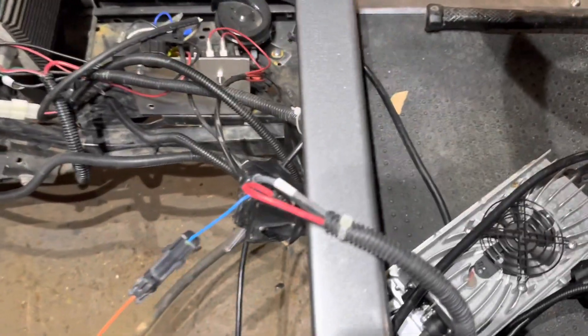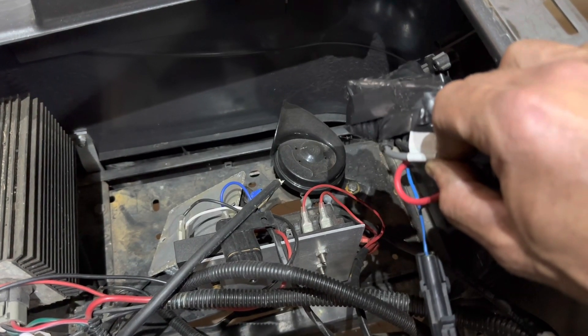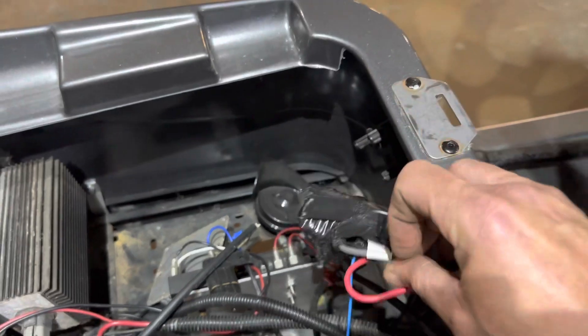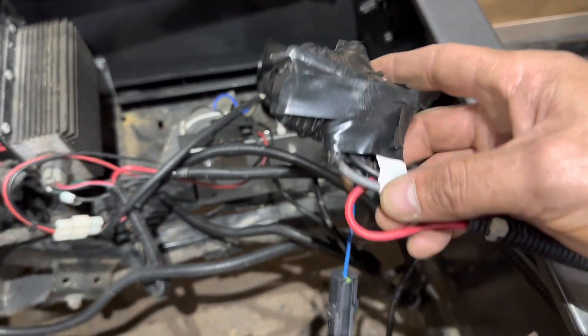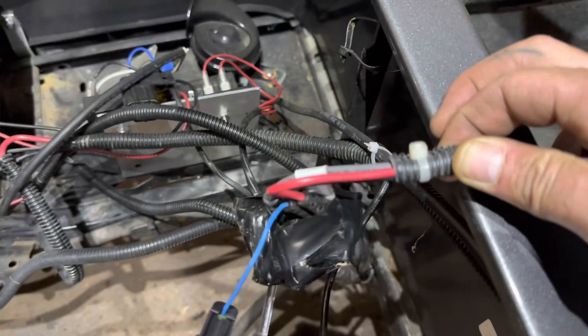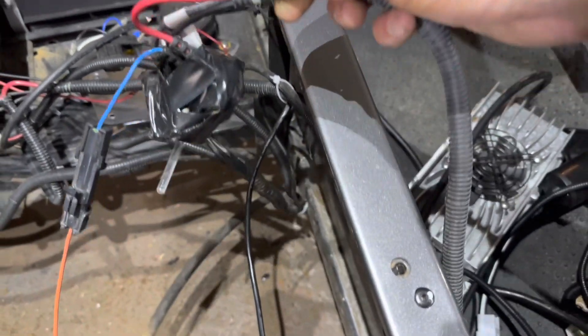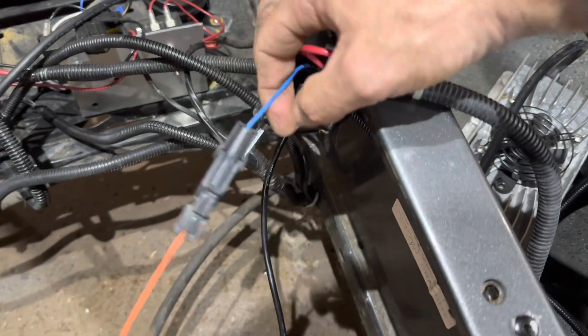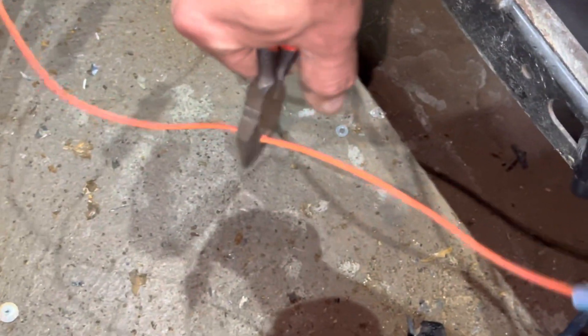At this point we'll go ahead and address the charge receptacle. There are three Phillips-head screws that hold the charge receptacle into the bracket — go ahead and remove those and pull it out. The black, red, and gray wires went to your old lead-acid batteries; you can just throw those away. The small wire, which is blue and turns to orange, is the reed switch — it keeps the cart from working while the golf cart is plugged into the charger, so it needs to be energized. We're going to come back about halfway and clip it.